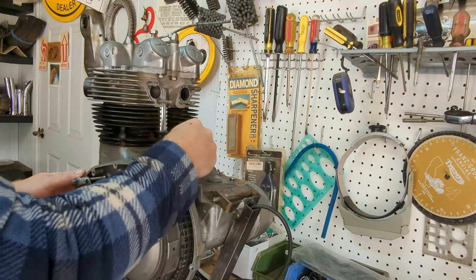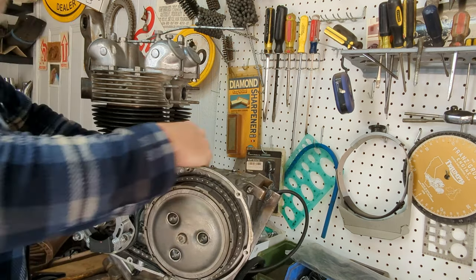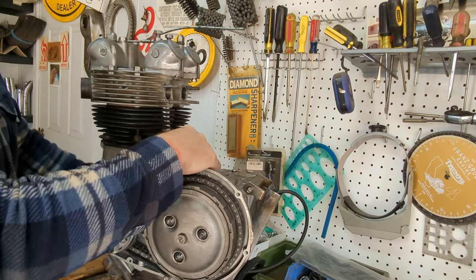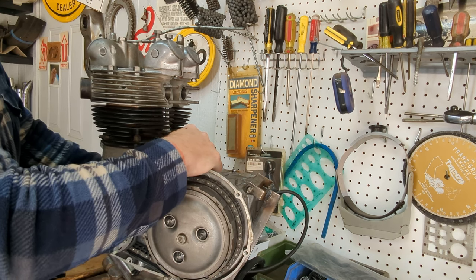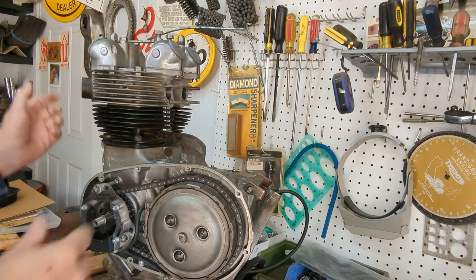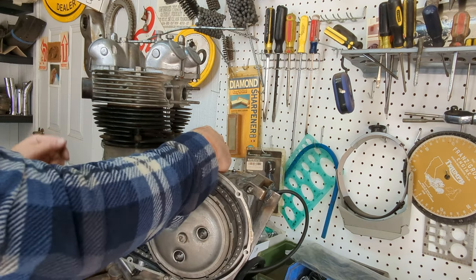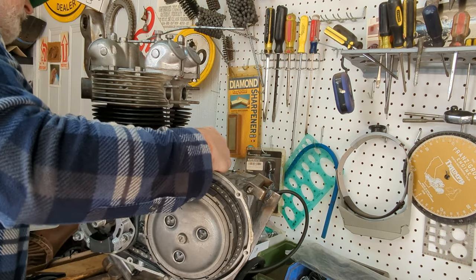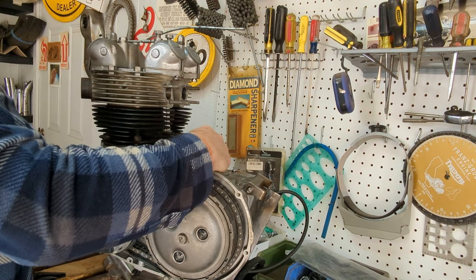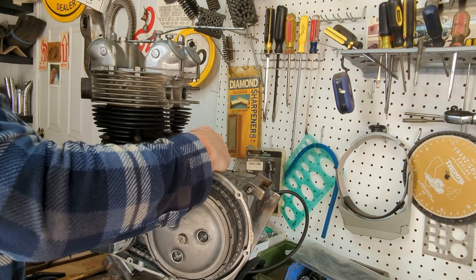And you put the little peg in. So we're going to move the crank until it just registers right there. So it fell into a little divot, and now you can't move the crank if you hold it in. That's top dead center for compression stroke. So we want to find 38 degrees before top dead center. So you pull your plug back out and you rotate the crank backwards. I like to go just a little bit beyond 38 before, maybe like 50.